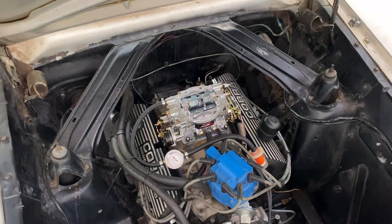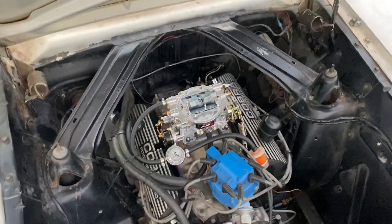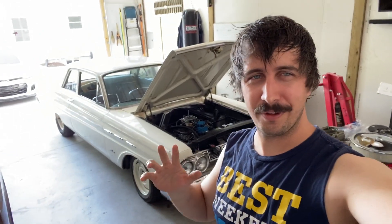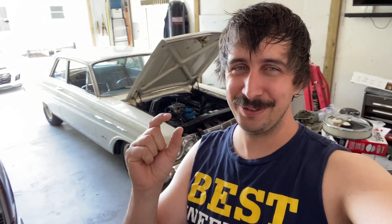Let's try it again. It's the following day — it's actually July 4th. Happy July 4th everybody. Yesterday I was really hoping to get this thing all wrapped up. I actually skimped on some of the filming — I'm sorry, I was really trying to get things put together. I ran into a couple of issues swapping over from the Holley to the Edelbrock. I had to actually extend the adjuster for the throttle cable, which meant I had to take two nuts, weld them together, and do all this crap. Anyways, it's kind of working.